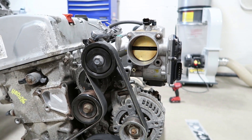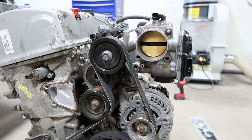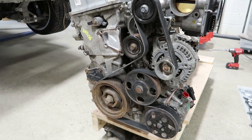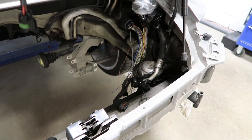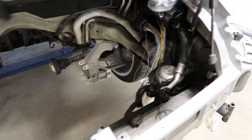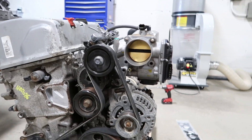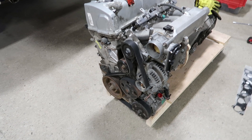So we have to figure out a solution for that. So many cars now have electric hydraulic pumps - older MR2s used to have them, and newer cars like the Mazda 3 and newer Altimas have them too. I'm just gonna get one and mount it somewhere - find some space in the engine bay or maybe up front - and use the Cyvex to control it to provide hydraulic pressure for the power steering. That frees up space on the engine for the throttle body and keeps everything as OEM as possible.